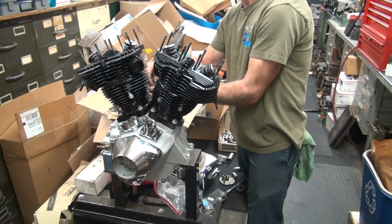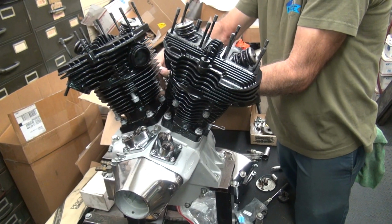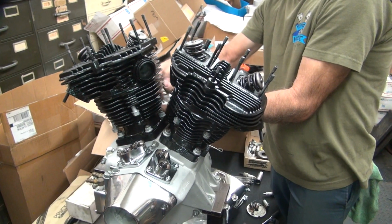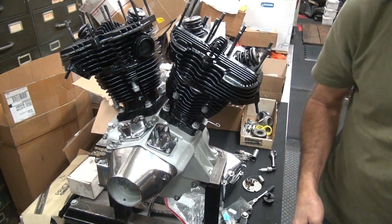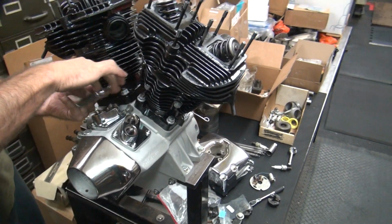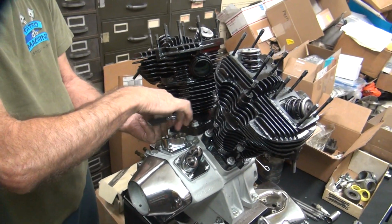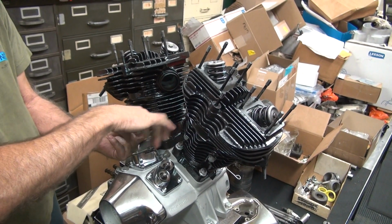Remember where the helicoil one's out, so we can make sure we don't over torque it. I don't know if it's the front or the rear head. Stay back from the camera quick. Oh, I think it's the rear. This is the rear head. The ratchet looks pretty good. These bolts have almost no drag on them because they tapped everything. Yeah.